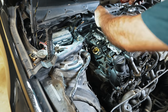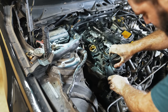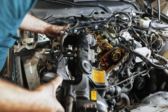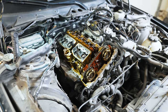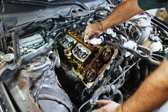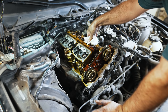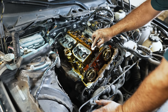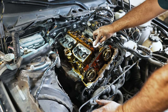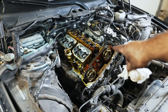We've got to squeeze on the sides here and pull out the brake booster line. Lift it up and out of the way. I'm using a T30 Allen key to go behind there and release three T30s. That's the vacuum pump removed. I'm going to go after the valve cover bolts now, starting from the center. If I had to guess the cause of the failure, there's a ton of sludge on these springs here. It's probably based on following the recommended oil change interval and getting premature wear in the plastic components. That's probably the difference between one car with low mileage versus one with high mileage. Or it could be heat cycling — lots of short trips versus long trips. But there's sludge, nothing crazy, and there's good even wear on the cams.